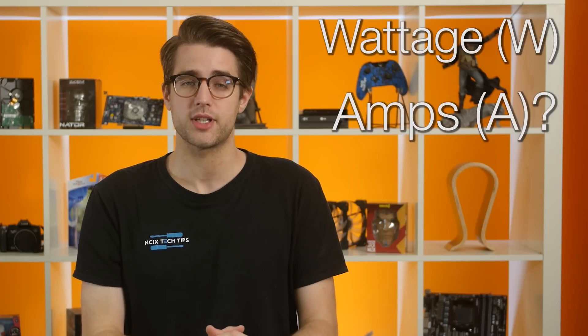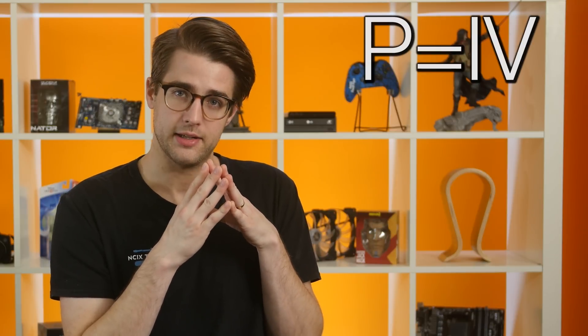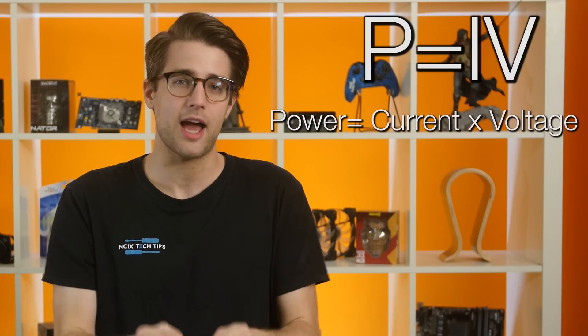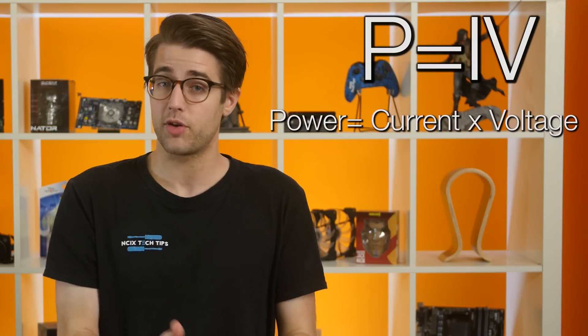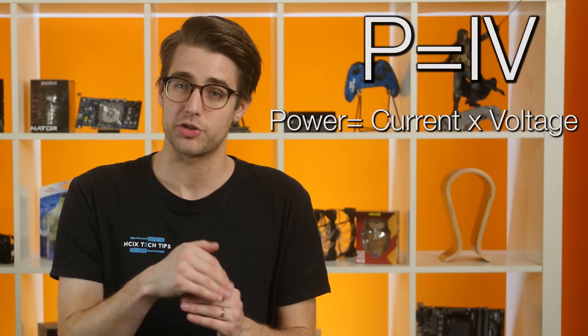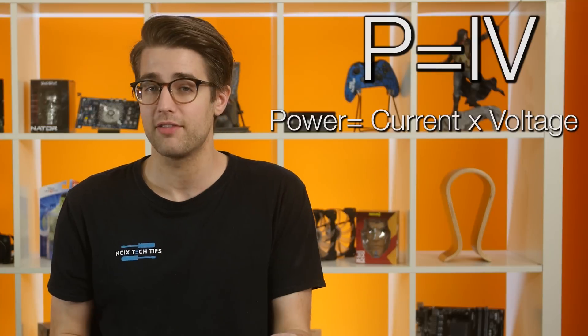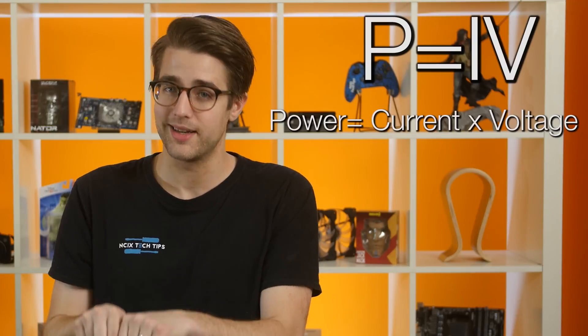A note first on our testing: for our comparison, we're ranking the power based on wattage. We know most chargers will advertise in amps, but think back to high school science — P equals IV, power equals current times voltage. It's the best overall number that describes exactly how much energy is going into your battery, because it's a direct relationship. If we go by current or voltage, they measure in an inverse relationship. For example, a charger could provide 2 amps at 5 volts, but it would provide less energy than a charger that gives 1.4 amps at 9 volts.